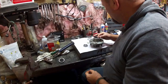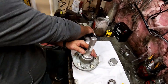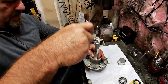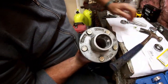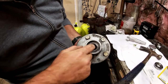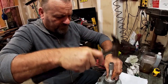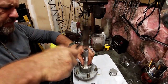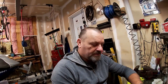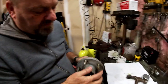Now we have our new races — nice brand new shiny ones. We're going to take this race and drop it in there. We've got our new race and our race driver — we're going to line that up nicely and gently tap that into the hub. We're going to make sure that race is bottomed out on its lip, and that bearing will sit right in on that race. That was the inner race — now we're going to do the outer race. This one has to go in a long way. Feel that bottom right out — it's in there. We have a new race on the inside, new race on the outside, both seated well. Be really careful not to mar the bearing surface — look how nice and shiny that machined surface is.